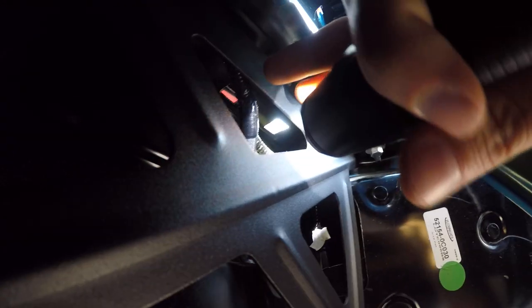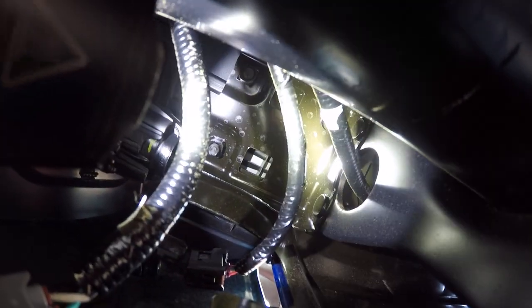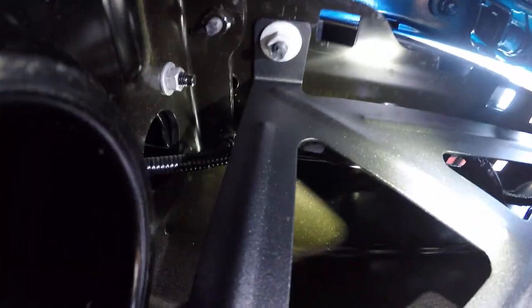Here's one of the square holes — the sunlight's coming through right here. There's another one you can see through this bracket that was kind of difficult to get to. With the trailer hitch, there's another square where those clips go into. There's a front and rear row of them that are hard to get to because you need to get that screwdriver behind the bracket. You just have to angle your screwdriver in multiple spots and be aware where they are so you don't break them.